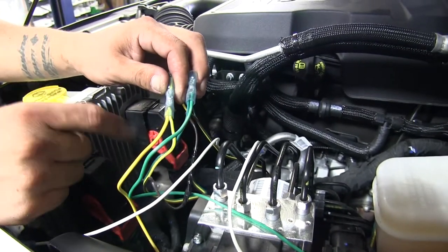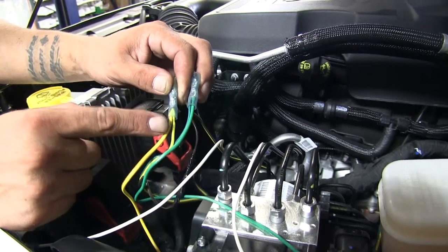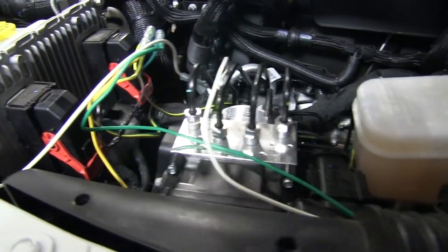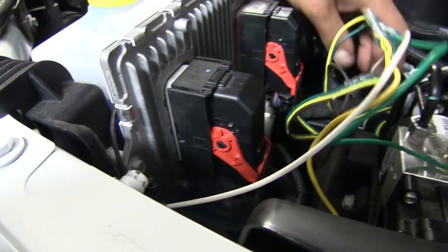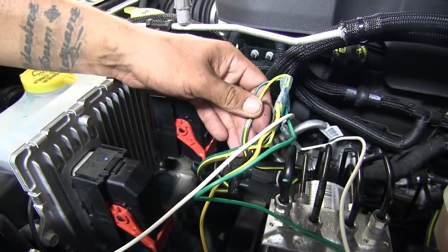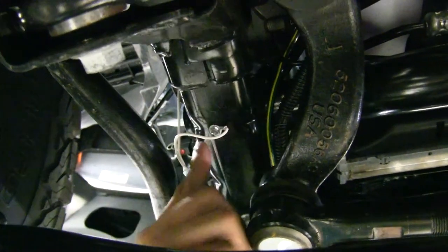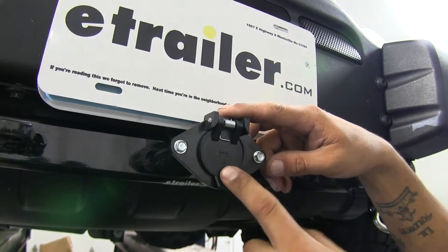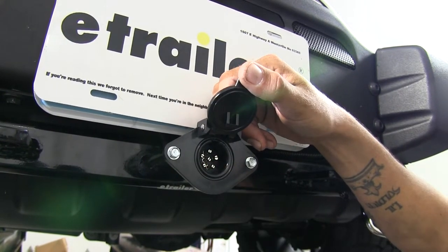I took my yellow and green wires and I tapped into the yellow and green wire for our lighting circuits coming from our RV. My white wire, I went ahead and grounded it at the chassis right here — there's going to be a factory ground point right against the edge. I put a butt connector in and ran it down to the ground that's on my four-pole wiring that I also had for my lights. It attached to the ground right here at the frame, and then it goes up front to the connector — that's what I mean by the lighting circuits or lighting wiring for our vehicle.